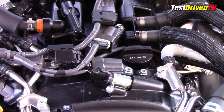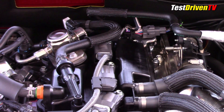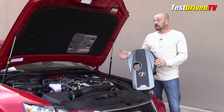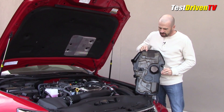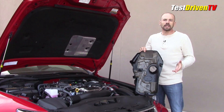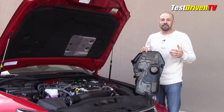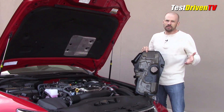In the era of plastic valve covers and complex fuel systems, they aren't as architecturally pleasing as they were back in the 1990s. The other reason they have engine covers now is because the latest generation of engines with direct fuel injection are very noisy — they have a loud ticking noise those injectors make. On the underside of these covers, they have foam sound-absorbing material and it actually works pretty effectively. This one doesn't have very much material on it — I was quite surprised. Some covers when I pull them off look like a huge foam mattress underneath, simply because they don't want you hearing the ticking of those fuel injectors inside the car and thinking something's wrong.